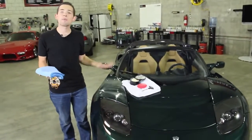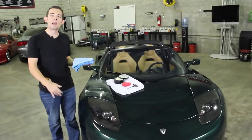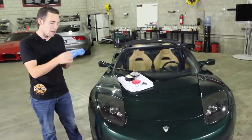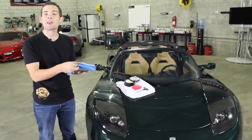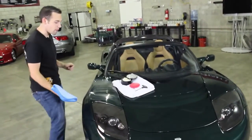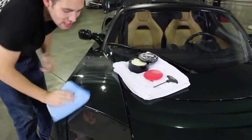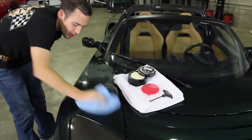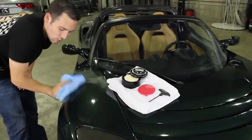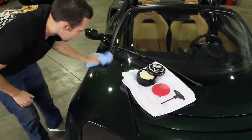We're back — it's been 20 minutes and now we're ready to remove our smooth layer of pure carnauba J97 paste wax. To do that, use a premium microfiber towel — preferably the softest available. I chose one of our extra-soft microfiber towels with a microfiber lining; they're extremely plush and give me nice control without scratching the surface. I'm going to fold it into fours, place it on the surface, and lightly buff off the excess wax. Look at that British racing green metallic really pop out from the paintwork — that's exactly what we want to see from Project J97.